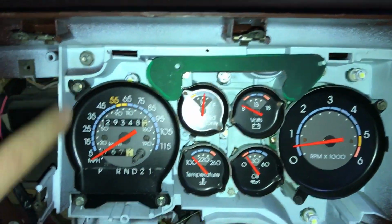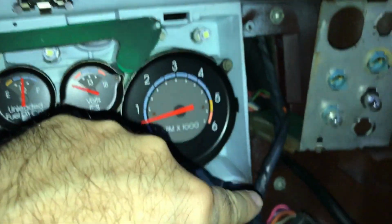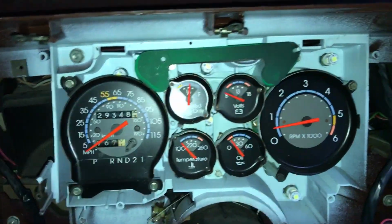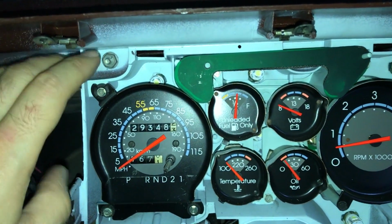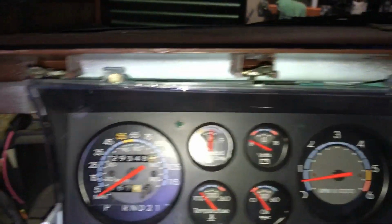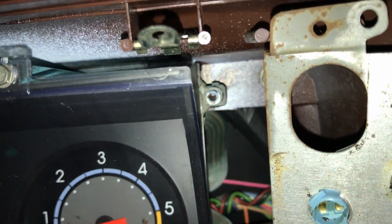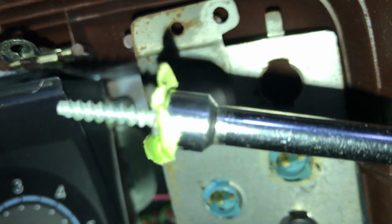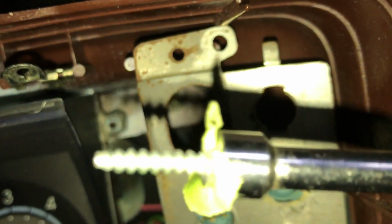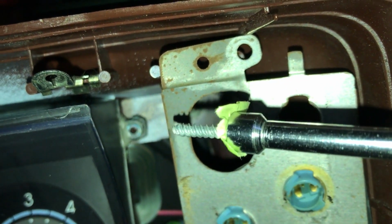Okay, so for this base assembly, I've got the 4 10mm bolts or fasteners in place, and now we're going to put on the secondary bezel cover over this area, as you can't tighten this one down with that bezel over that, so you need to make sure that this fastener is in here first. Remember that the longer of the 4 goes in the corner here. For some of these fasteners, it can be very difficult to get back here and hang on to the fastener without it dropping down. What I've done here is just take some tape and put it inside the driver to make the fitting of the fastener snug, so that if I hold it horizontally, it's not going to fall out. This is an easy way to get it in this hole without it falling down.